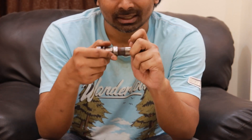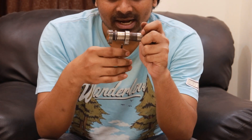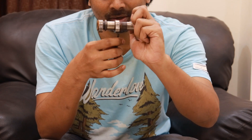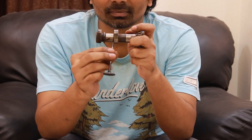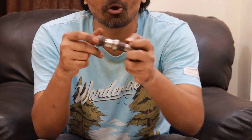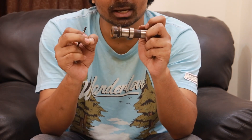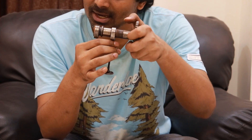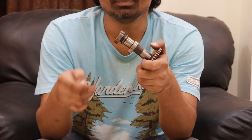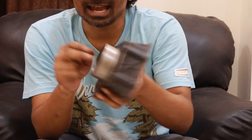This area is where the timing chain is put on — I'll show the timing chain in the next video. The timing chain rotates the camshaft, and the camshaft touches and pushes the valve down as it keeps rotating. This part actually pushes the valve down when it rotates. It's a continuous process — that is why it is known as timing. When the timing is right, this area pushes the intake valve down, and at the right time the exhaust valve is pushed down by the other camshaft, so exhaust gases go out of the cylinder.